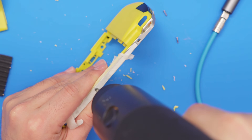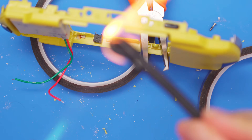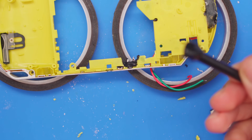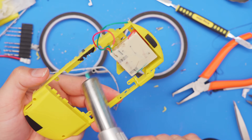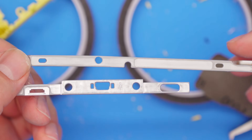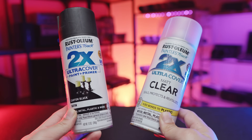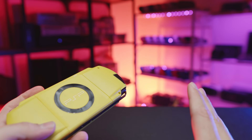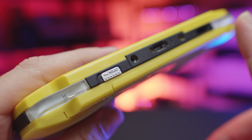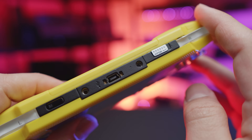After marking the point, I used a large drill — which was a bad idea, I should have tapped it — and ended up with a suboptimal cutout. I contemplated my life choices for a couple minutes and decided to just let it go, thinking once it's all painted black it should be fine. And I was right — once it was painted, the end result speaks for itself. Once all the cutouts were done on the trim pieces, it was time to start sanding things down to prepare them for painting. Essentially we used Rust-Oleum Canyon Black and finished it off with matte clear coat — and that's how we got this very nice finish. The tip I can give you: do light coats and let everything dry properly, especially after the final coat. Because I rushed things, we got some areas where the paint was damaged, which I touched up with a pen.